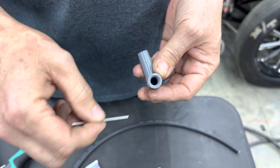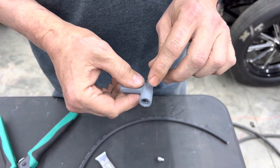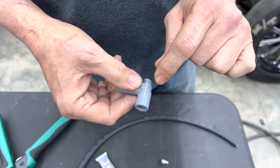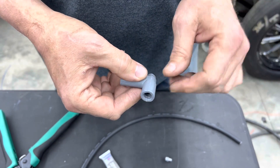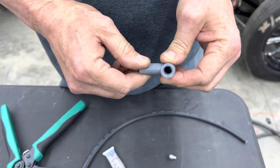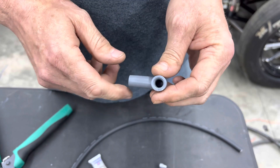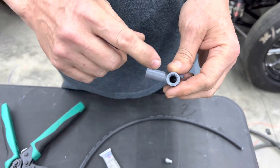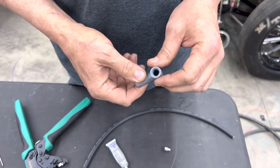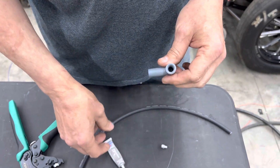You want to do that on both the plug side and the coil side. A lot of guys don't believe in this, but I can tell you that if you don't use it, you're more likely to have arcing where it burns a little pinhole in the boot — especially on a plug near a header — and you'll have misfires. You'll see a lot of noise in your EGT readings and such. Simply a good wire and grease on both ends of the wire solves a lot of problems.